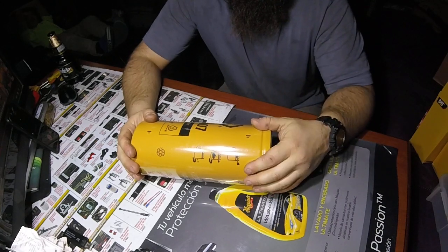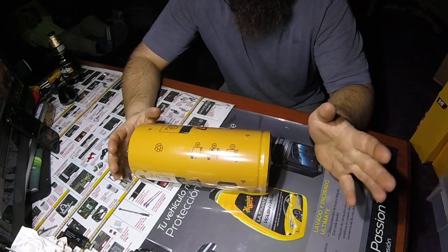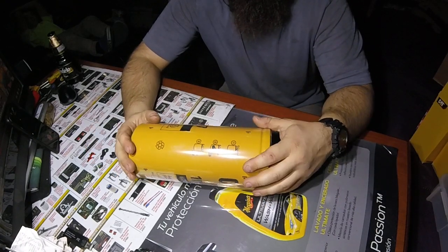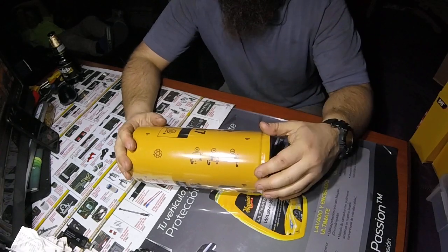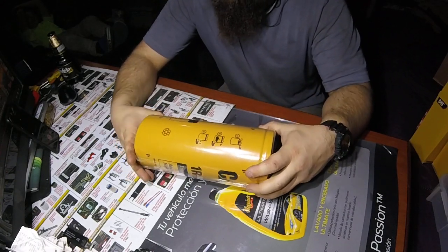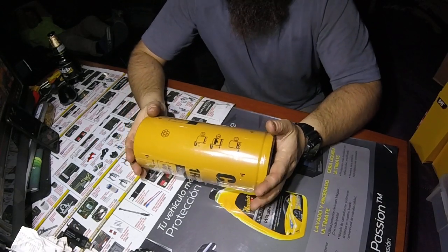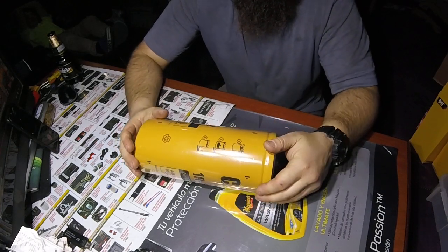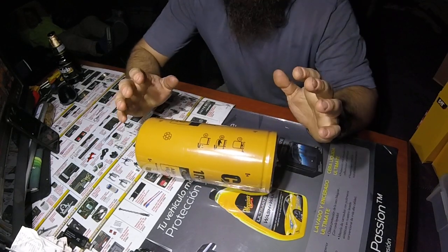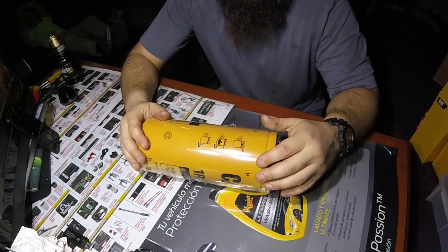It's also the Achilles heel of these engines. They need absolutely perfectly clean oil. I'm not saying it's got to be brand new all the time, but they're very sensitive to oil quality and oil flow for cold starting, for longevity of the high pressure oil pump. Those things can get expensive when they fail. So I figured, instead of, I didn't even price a Wix filter. I went straight for the Cat.